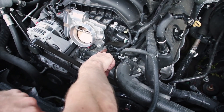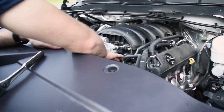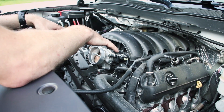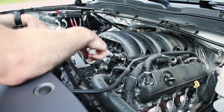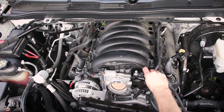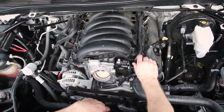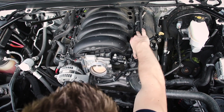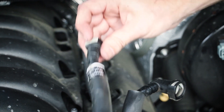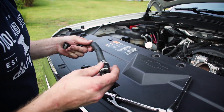The inlet of the catch can is going to attach right here to the crankcase, and the outlet is going to attach up there to the PCV system. This area does get hot so you probably want to have your truck sitting for a little while before you do this. If you have the 4.3 liter V6 or the 6.2 liter V8, this process is the same except your PCV line will be in a slightly different location. I'm going to remove this bottom clamp and work that underneath the line. When you rotate this up towards the driver's side, you can see the clip we need to remove. Push down on the exposed part while pulling — it comes right out. We will not need to reuse this part, but save it in case you ever want to take the truck back to stock.